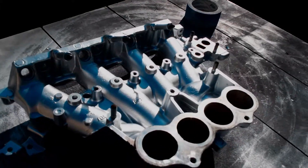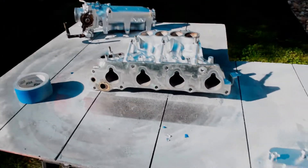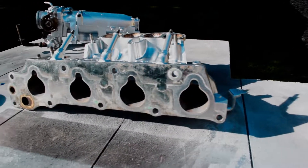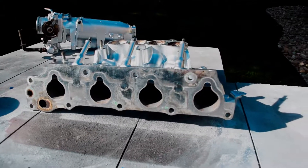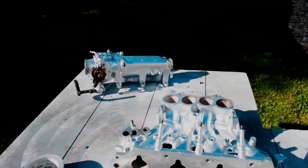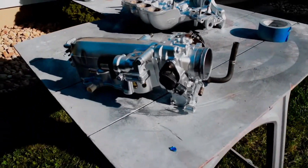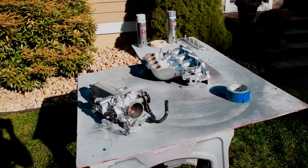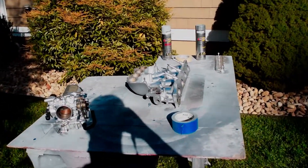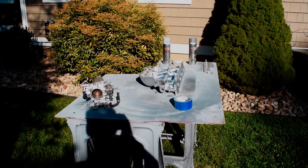I may or may not deck the surfaces — this one looks okay, but the intake surface here I might try to get something flat with a piece of 220 sandpaper and just deck it to get rid of the nasty-looking areas so the new intake gasket seats well. Other than that it came out looking really good. It beats buying a new intake, but it looks like one, so works for me on a budget.